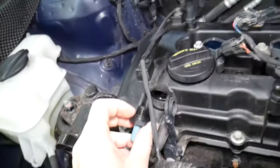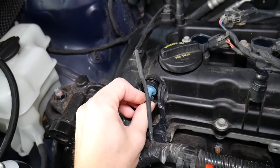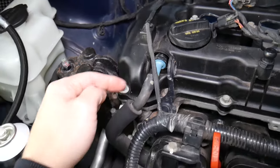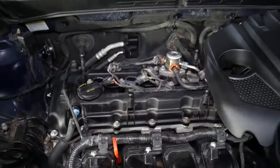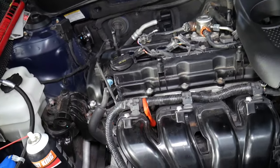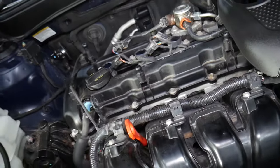On this car, we're going to remove the engine cover and the PCV valve is usually located on the valve cover. What that valve does: it sits right here with a hose that goes to the intake manifold. When your engine runs, the pistons go up and down — that creates pressure. If that pressure is not released from the engine, you'll fail seals and gaskets, develop multiple oil leaks, and can even blow a head gasket. That device takes out the pressure and injects it into the intake manifold, where it goes to the cylinders and is burned through the exhaust.